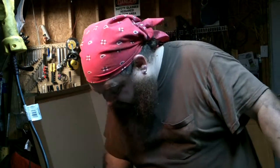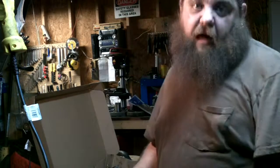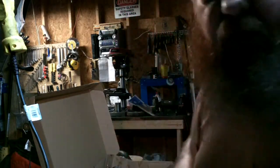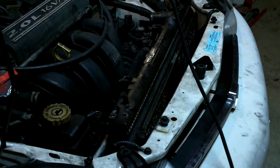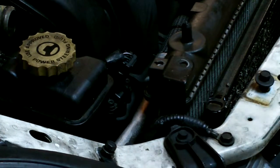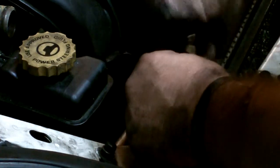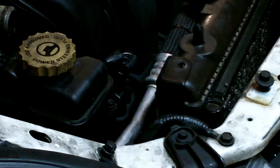The book tells you to take the brackets off top side, left and right — they're similar. It doesn't say anything about the bottom. When you come up under the bumper, you can tell there's another bolt here and another bolt here on the bottom. That's why I couldn't pull it out and I wasn't trying to force it. I had to show you what I did here. So I'm going to remove those bolts — 10mm again — so we're not doing too many tool changes. I didn't understand what it meant by leaning forward, but you just got to pry it up a little bit and it pops forward. I'll put them back in right now so there's no tension on those bolts underneath.